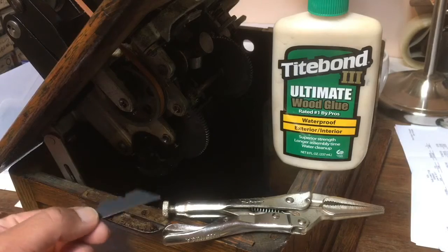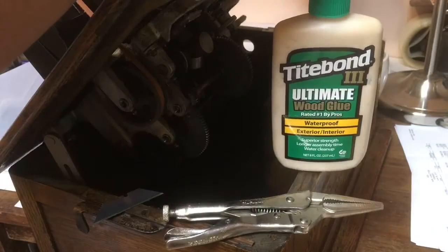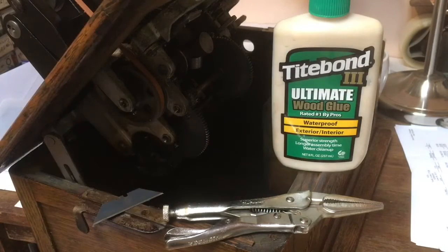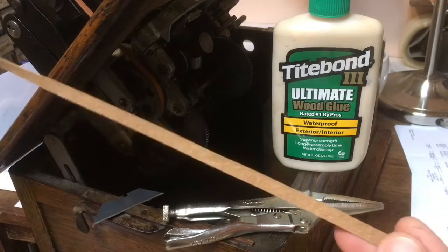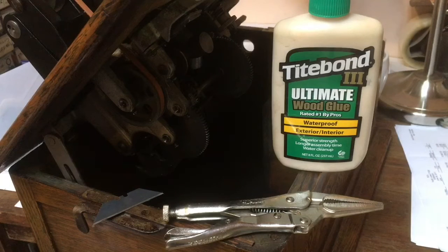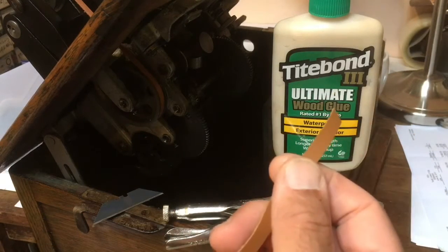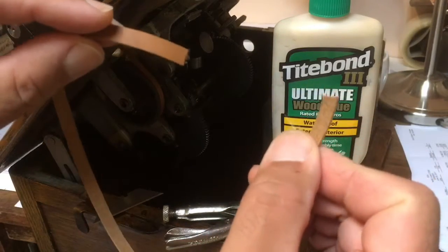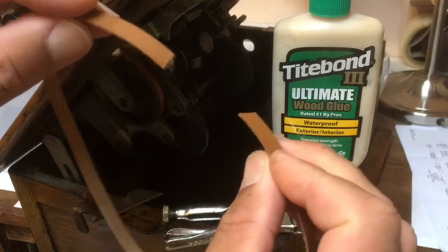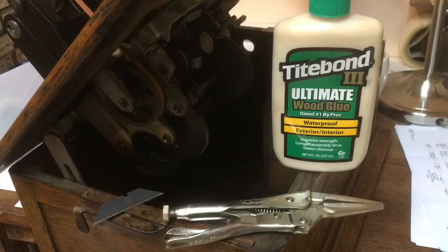For this job you will need a new sharp razor blade, a pair of vise grips, and some wood glue. I only use wood glue because it's a little bit stronger than Elmer's white school glue. And your new piece of belt. For a Triumph it takes about a foot of belting. I tell most people to get two feet just to be safe in case you have a few bad splices if this is your first time splicing drive belt. After we remove the original belt, we're going to cut a bevel into the edge and do what's called a lap mending on the belt.